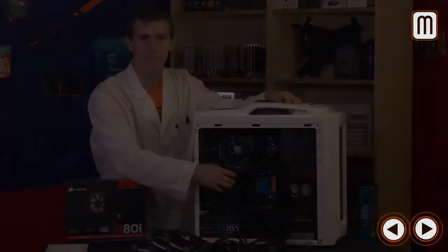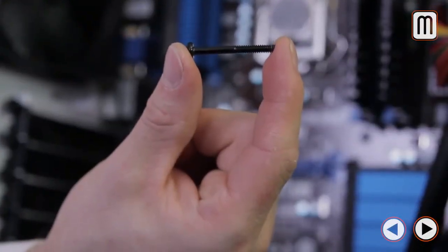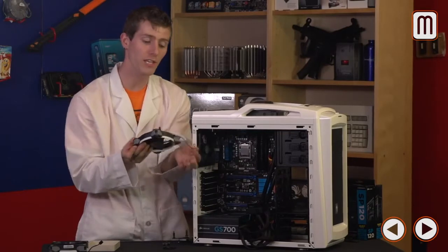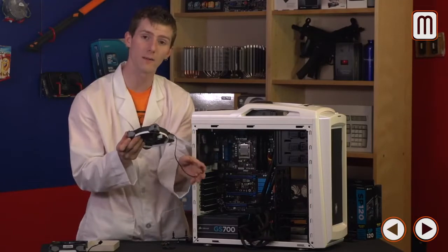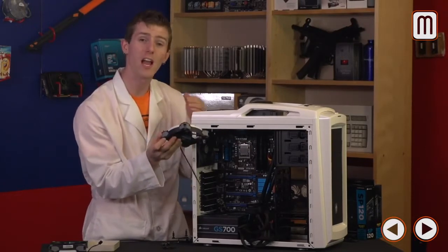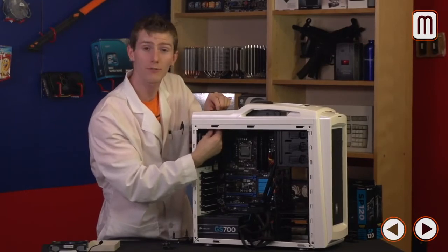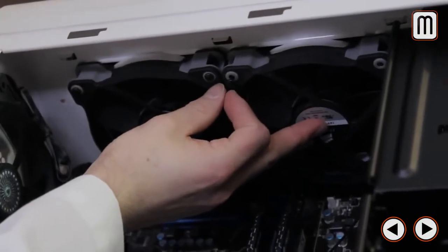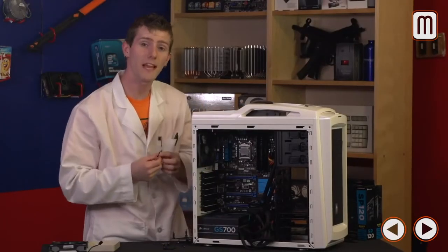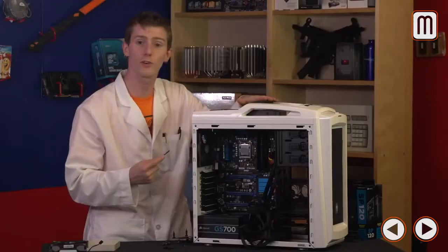Pop out the top piece of plastic on the case using the tabs inside, get the radiator in position, screw the fans in from the inside, then mount the CPU block and pump combo to the processor. The trick with mounting the fans to the rad with the H100i is getting the right screws — there are a lot in the box, so consult the manual. We go through the fan, through the top of the case, and into the radiator. Position the three-pin fan connectors near the back of the case to hide them. I prefer pulling air through the radiator rather than pushing — it allows you to clean it more easily without removing the fans first. The SP fans also have rubber noise-isolating mounts, passing fewer vibrations and meaning less noise.